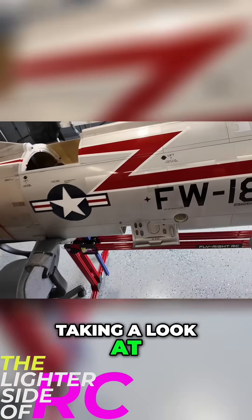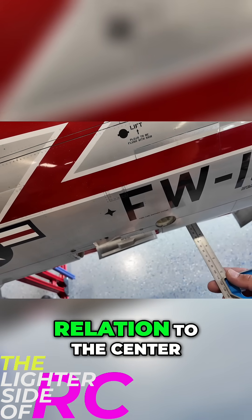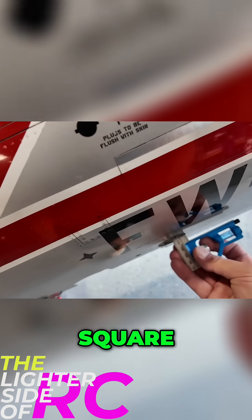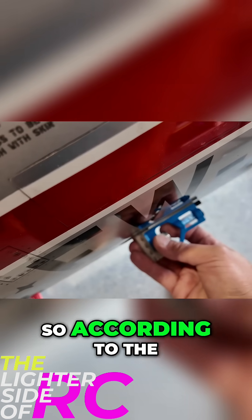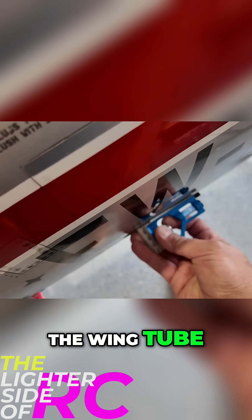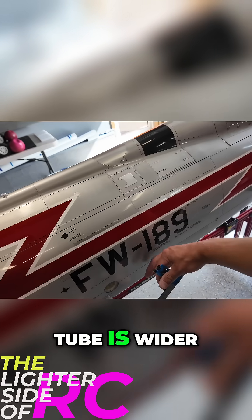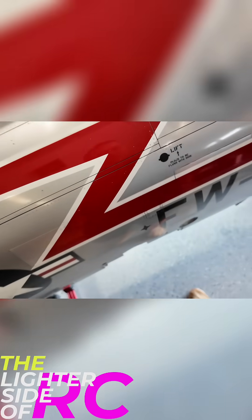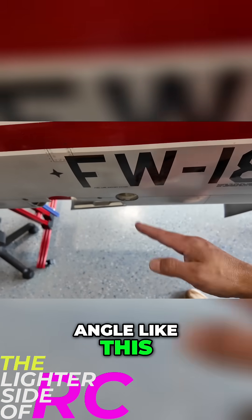Going to get my head wrapped around this gear. One of the first things I like to look at is the sides of the fuselage — how are they in relation to the centerline of the aircraft? That's an important thing when setting up your landing gear. If we take this square and tuck it in like this, you'll see that according to the centerline of the aircraft I'm squared off on the wing tube. The forward portion or area forward of that wing tube is wider than the back, as you can see. So the fuselage compared to its centerline naturally has more of this outward angle.